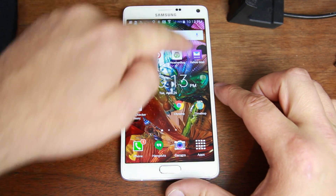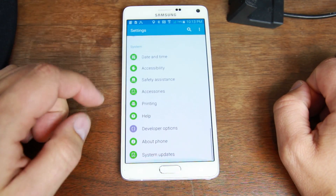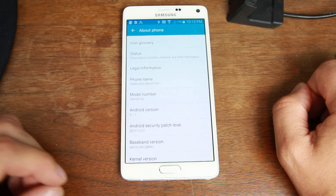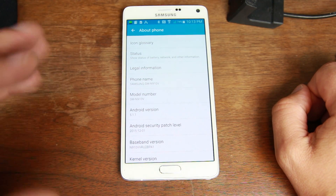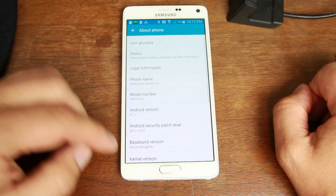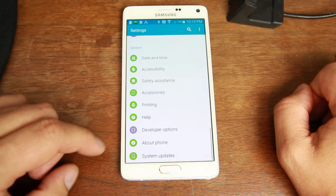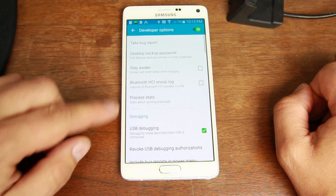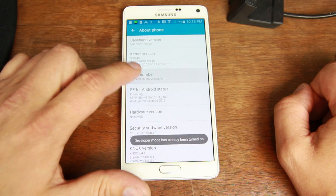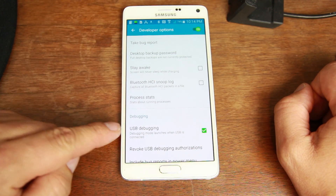The next step is to show you what we're working with on the device. Now that your computer is all set up and ready, it's important to get that set up first because root access on this device is very fickle, temporary, and a pain — you might lose it while running the process. So have all your computer files set up first. You can see I'm on the Verizon Note 4. Next, turn on developer options: go to About Phone, tap the build number a bunch of times, then make sure USB debugging is checked.